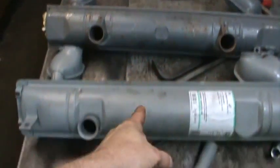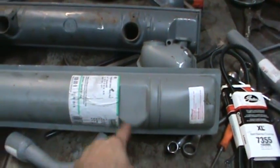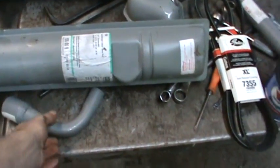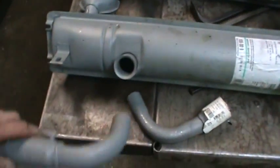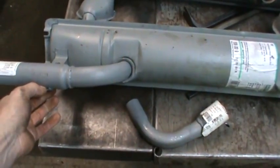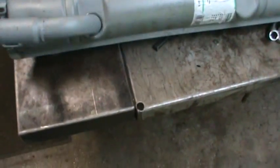What we have here is a Beetle muffler, and that's a bus muffler. Pretty much you can kind of see where it started out as a Beetle muffler — it would have had another one there. The one I put on there I pretty much just cut and welded the end off. Now I have to try to come off of this with an exhaust. This is what factory would look like, kicking off to the side, with a tailpipe exiting out from under the bumper. So I just have to come up with that same kind of idea.